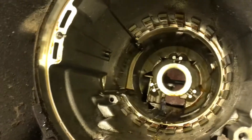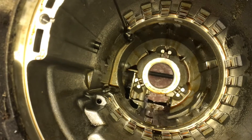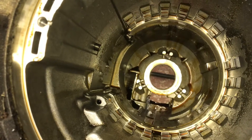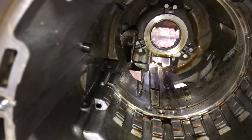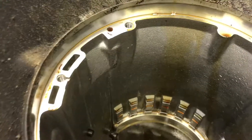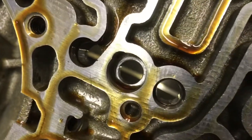Now the case is empty. I pulled out the rear band and the fretting washer. There's a selective washer that goes in those three tabs down at the bottom of the case to take the thrust and save the case, so the case never sees any stress. The rear bushing — you can see it back there. If you convert to a bearing, I like to drive the bushing in just enough to kind of center the bearing; it doesn't affect a thing. That's a trick a lot of people do. This case looks really clean inside despite being pretty nasty on the outside — a pretty good deal for what I paid for it. You want to watch where the bolt goes through for the center support; it's not all backed out, but it's in good shape.